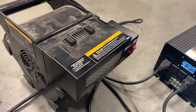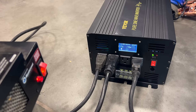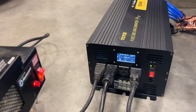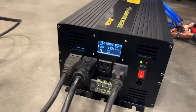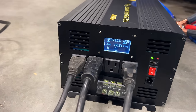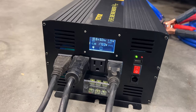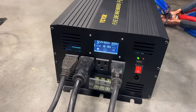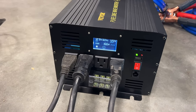I'm going to plug in a second fan that has a big heater on it, so we should really be able to draw pretty good current. Turning the other fan on to high — we're using 1,200 and now 1,600 watts of power. It is starting to beep because we are drawing the batteries down, so I'll start the engine. With the engine running, we're back up to 13.6 volts. It looks like 1,600 watts is more than my alternator can keep up with. If I turn it off, we're back at 166 watts and the voltage is coming back up again.